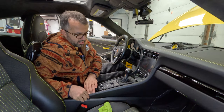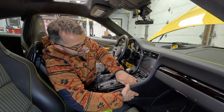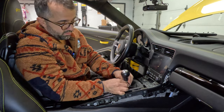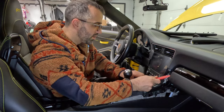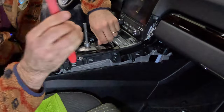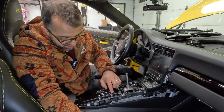Getting started, we're going to need some basic tools. But before we get to those, let's start popping up these panels — you can best pop them up with your fingers, just out a little bit and then pull them towards you. To remove the shifter first, you click the base and to undo it you squeeze the base, flick it left, then grab this little tool and simply pry it up and pull up. Then we're going to start removing this trim around it.